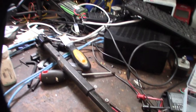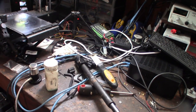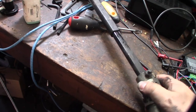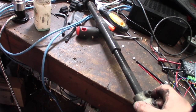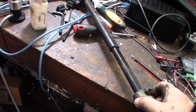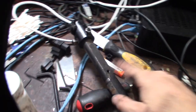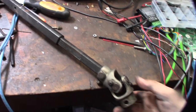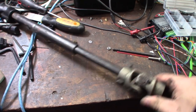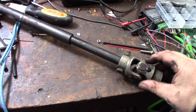All right, so I got it off. Maybe I can show you under the light here at my workbench. I want to show you how much play there is — it's between the shafts here where they couple together. See that? I'm barely touching it but that translates to a big movement in the steering wheel. This thing is actually held on typically with the zerk fitting — the grease fitting — and it was never tight when I first installed it. I also think I need to adjust these end caps; one is looser than the other.